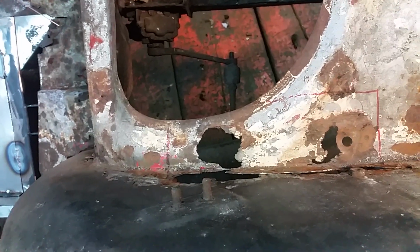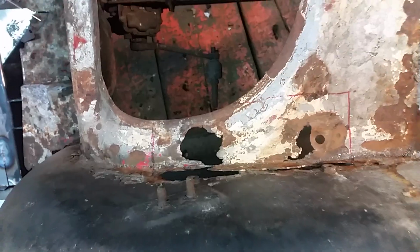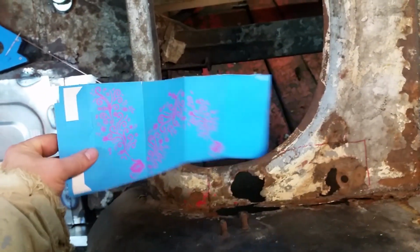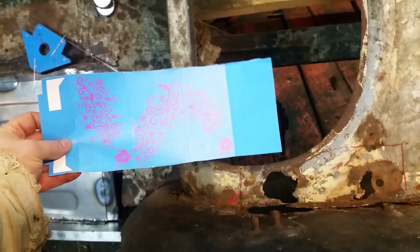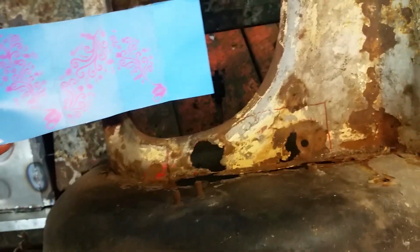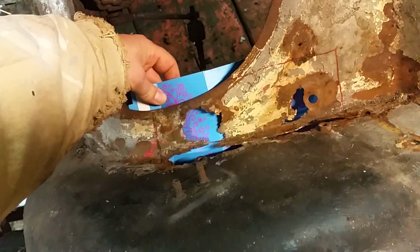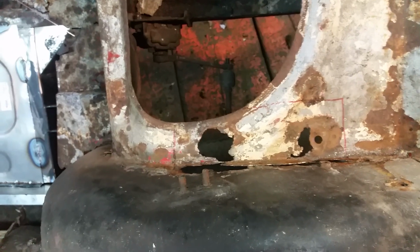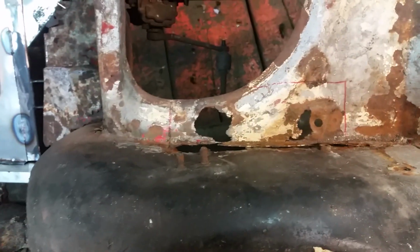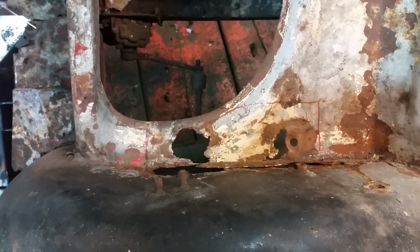And to start out, I'll be using a CAD template, and that's not computer-aided design, that's cardboard-aided design. T-packages, cereal boxes and stuff like that. I'll cut this out, put this under here, trace around it, so I have a rough idea of the shape I need, and then transfer it over to the steel. Then start pounding away until it takes the right form. That's the plan.